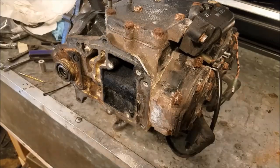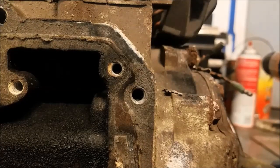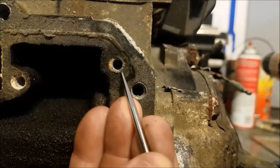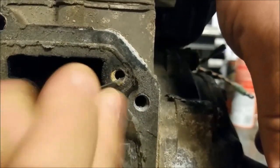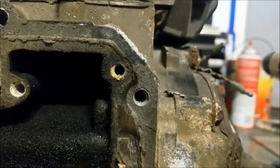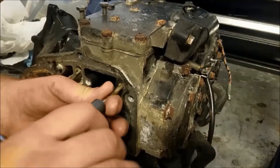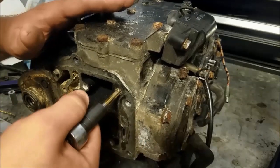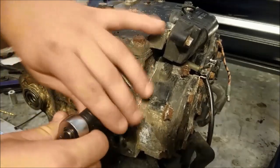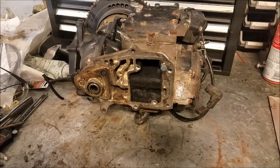Our hole is now drilled out. There's just a little bit of thread or old bolt left. I think the tap will clear it out — I'll try a pick first to get some threads out. They're pretty in there still, but there is some steel remaining. Let's get a tap. I have my quarter-20 starter tap, which should grab some threads and just pull out that steel. You can see the steel chunks coming out — seems like it's working fine. The screw is straight, it threads in, it holds tightly. It worked fine, considering we're using a hand drill.